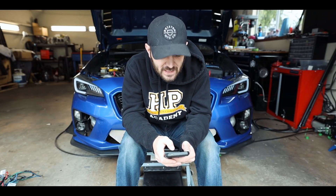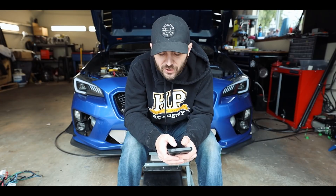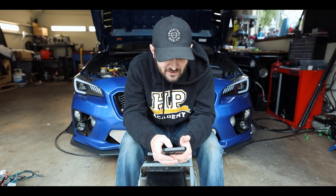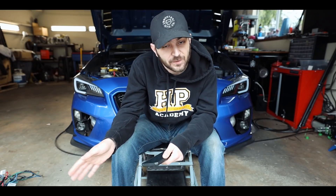Now for Motec. For 2015–2019 WRX FA20 DIT owners, the unit is the M142, coming in at about $6,900 before tax and shipping — Motec is essentially the Gucci of aftermarket ECUs based on price. With the FA20 using direct injection, there aren't many tuning options, so you're somewhat limited until more options come to market. Motec also supports the 2009–2010 WRX with the M800 unit at $3,500. There's also an M150 unit but I couldn't confirm exact year ranges, so that was left out.